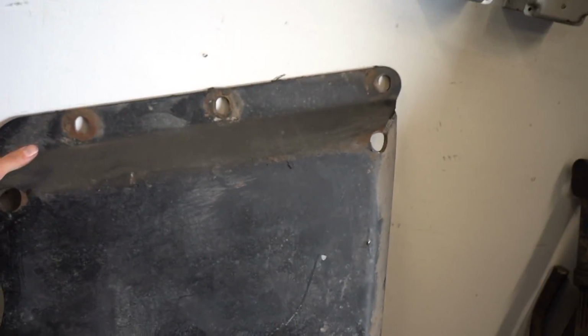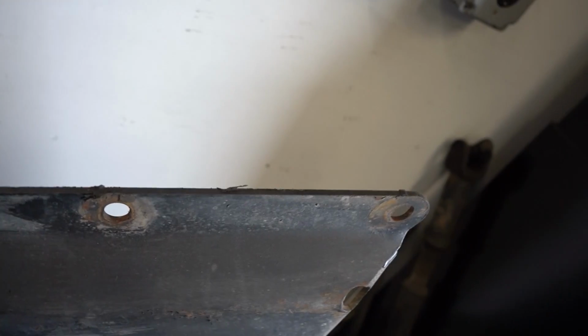And I think by doing a motor mount lift, and if I have to, I will raise my frame height, which right now is at 20 inches, which is actually really low, because then my belly is only going to be probably 18 inches if this is my skid right here. So I do have plenty of adjustability. I do think I might lean towards just going up with my frame height. It would be easier in the future to lower the frame height with other mods or do a flat belly. So that's where I'm at.